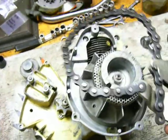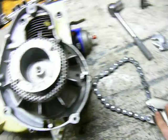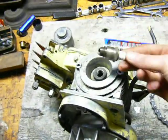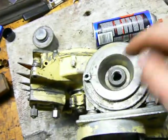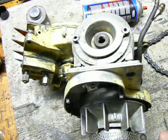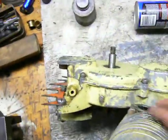That's the basics to loosening up a flywheel nut. For two-strokes and chainsaws especially, another handy tip — if you don't have one of these strap wrenches — is to take out the spark plug. Take some synthetic rope and shove it down into the spark plug hole. You don't need to shove it down too much, just enough to kind of jam up the piston. So when you put a wrench on the flywheel nut and try to turn the flywheel, that will turn the piston and eventually jam it up with all that rope in the cylinder.